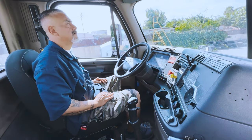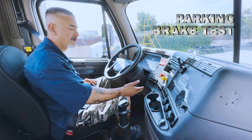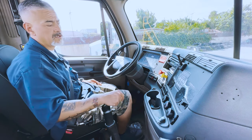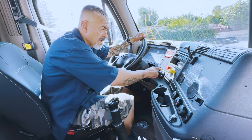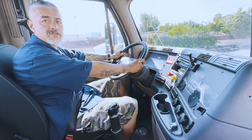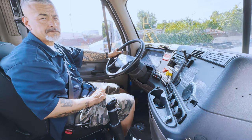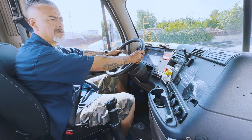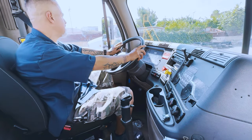Once you think you're done with the trailer, tell the examiner. That was my in-cab checklist. Pressure's at max now. My next test is my parking brake test. We're going to make sure that our parking brakes and trailer brakes hold. Put the clutch in and put it in first gear. I usually test the trailer first. I'm going to test my trailer brakes by releasing my parking brakes. Start releasing the clutch — when you feel that little tug, push the clutch back in and say my trailer brakes hold. Then pull your brake up. I'm going to check my parking brakes by releasing my trailer brakes — same thing. Release the clutch a little, feel that little tug, put the clutch back in and say my parking brakes hold. Pull your brake out, put it in neutral, and tell the examiner this is a good test.